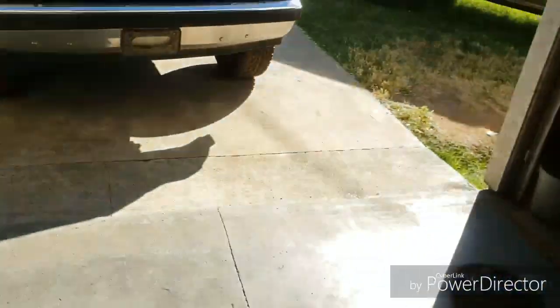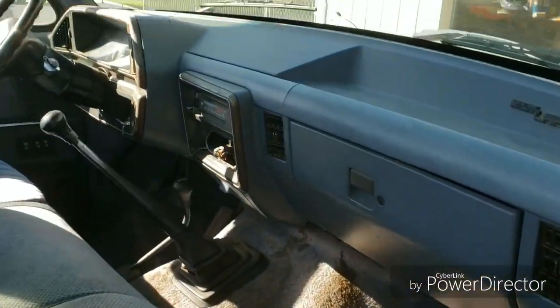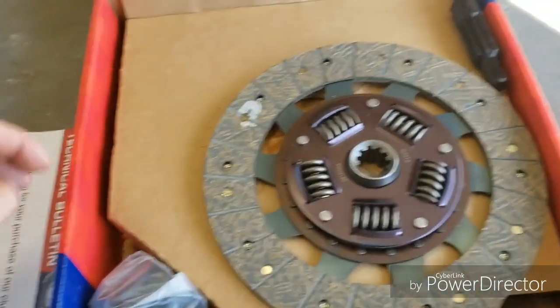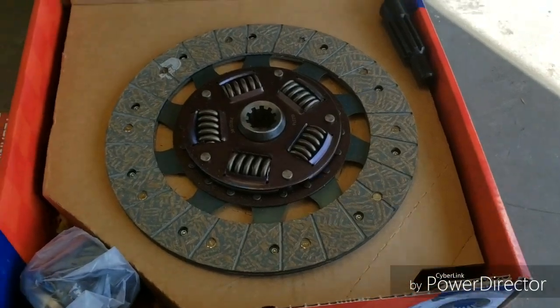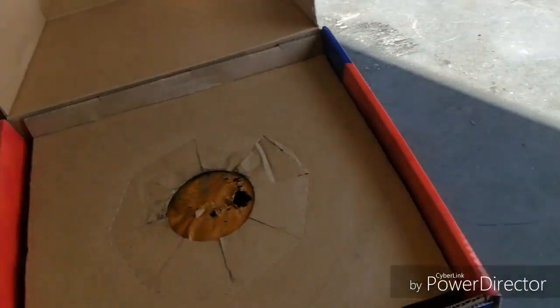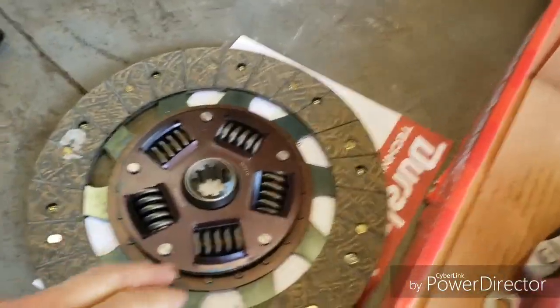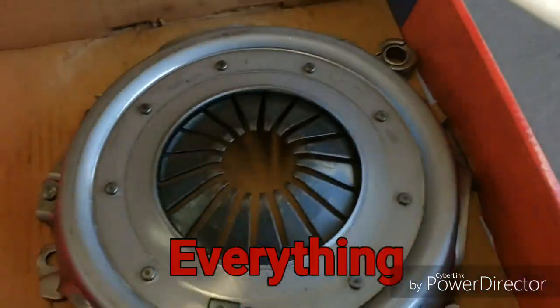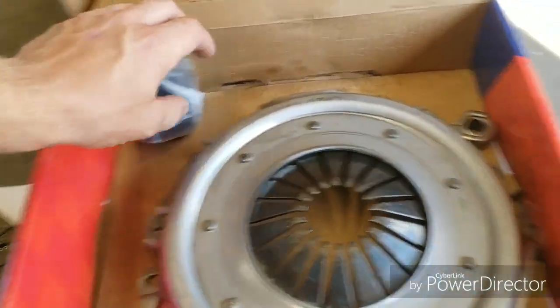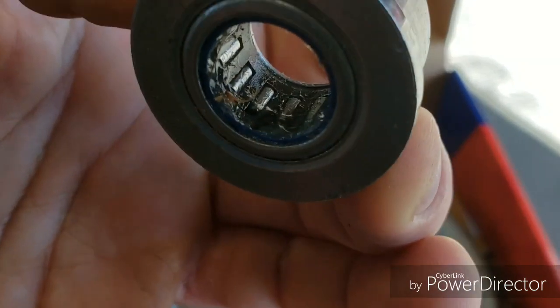Good morning guys, welcome back to the garage. While we're still waiting on parts for the Chevy refresh, we're going to try to do a clutch in this bad beast. It's a Lariat so the inside is kind of clean, actually not too bad for its age. We've got the friction plate — Duralast is carrying not just an OEM but an upgraded, heavier duty clutch than stock. We've got a throwout bearing, new boot, pilot needle pilot bearing.